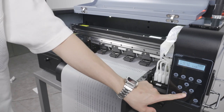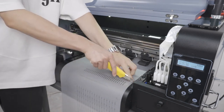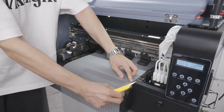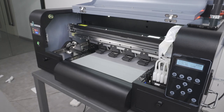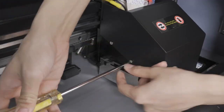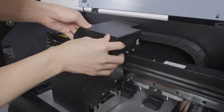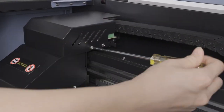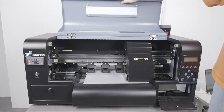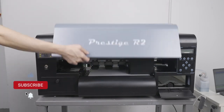Alright, to finish off, you can push the down arrow until the printed media is clear of the printer bed. Cut the excess off. Then replace the cover to the printer carriage and secure it by tightening the screws. Next, place the cover back onto the motherboard and secure it by tightening the screws. Now close the lid and secure it using these two screws. That's it for this video — thanks for watching.